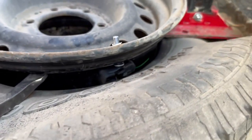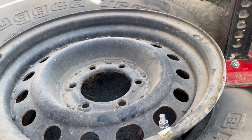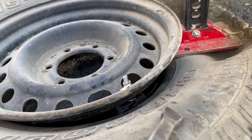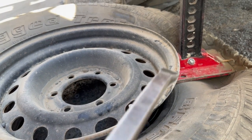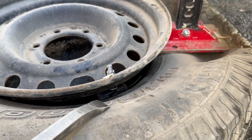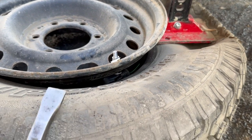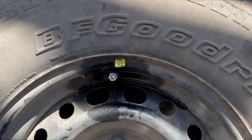Another tip: when you are allowing the bead to come back over the sensor, be very careful. If there's too much pressure from the tire slipping over, that's why I've got this offset — not pressing down right there. You've got to make sure the bead goes around the sensor, otherwise it'll snap it off and then you have a broken sensor that is 100% useless. Once you're all aired up, check your work.